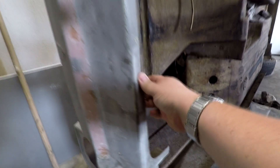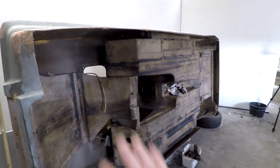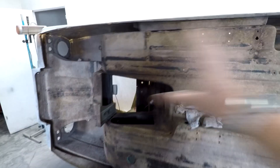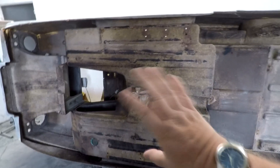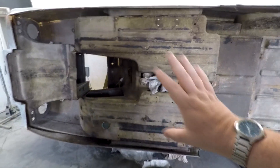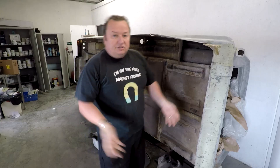Looking underneath now, we're virtually there. There's a couple of little bits to do - there's another little crack on the front there. These little things have just got to be done, but first of all I've got to clean everything off here, and then that will be ready for paint. I've decided to go for a grey paint underneath - if we look inside the engine bay, it's a grey type of paint anyway, so I was going to stick with that and give it some sort of original look. So it's going to be a 1K paint. I've ordered the paint and I'll probably either paint this on or roll it on to get a smooth texture, because this is a very textured finish anyway. Once it's on, it'll actually protect the underside, which it hasn't had from new.